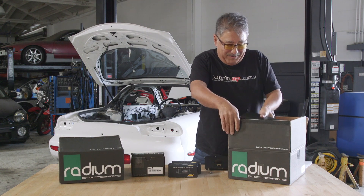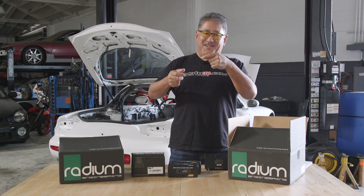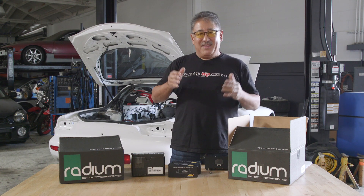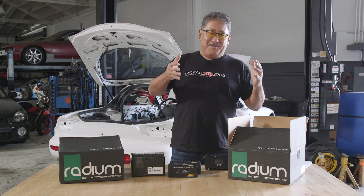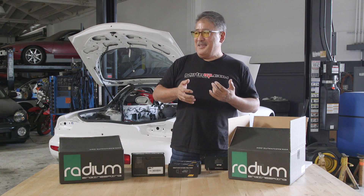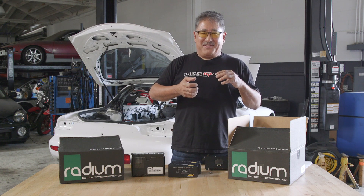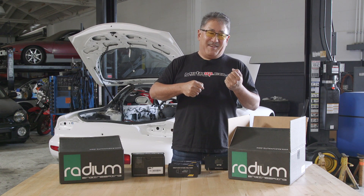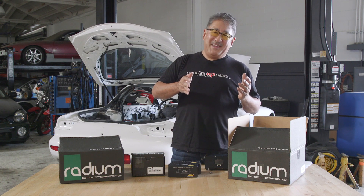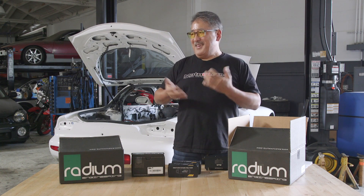What I really like about this setup is that a lot of people run an external surge tank, where the lift pump actually pumps fuel out of the fuel tank into an external tank mounted somewhere in the car, which goes to the high pressure pumps and then the fuel rail. That works really well to prevent sloshing, but it's a big source of leaks and possible fuel for fire in the case of an accident. I was just involved in helping out another driver who was in an accident and the car got really distorted in the crash. The lines to the surge tank separated and all the fuel in the surge tank went all over the place — it was really a lot of luck that there was no huge fire. That's one of the reasons why surge tanks internal to your gas tank are better, at least in my opinion. Safety is a big part of it.